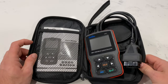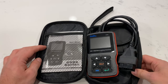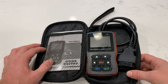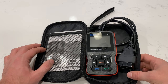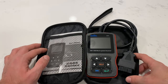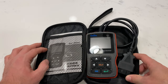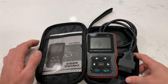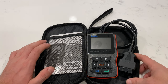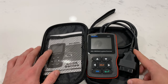The scanner came in a nice pouch that I keep in my car at all times. I've had it for almost a year now, and it actually saved me more than once where I would have been stranded on a highway or had to call for service. My car went into limp home mode and I wasn't able to drive faster than 20-30 miles an hour — not really safe on the highway. I was able to reset the codes and continue driving. It was a bad ignition coil, so the car shut off fuel to one cylinder, putting it in limp mode. Once I reset the code, the car drove fine, and it would only stutter above 5,000 RPM or so — enough to get home and do my own maintenance without calling a tow truck. The $60 or $70 I spent on the scanner definitely paid off.